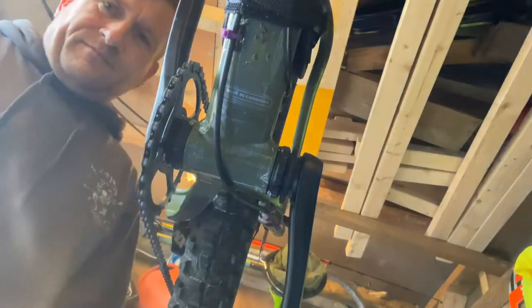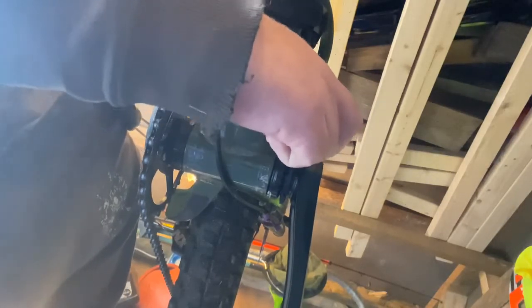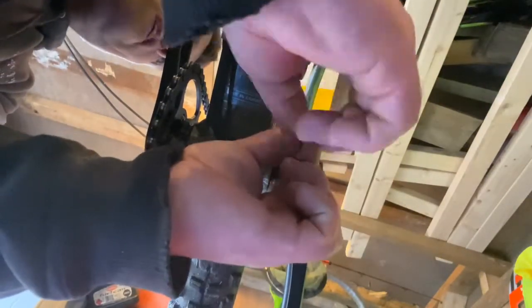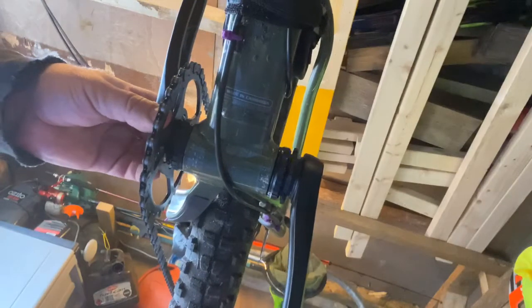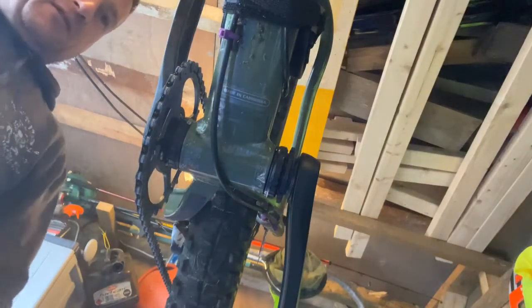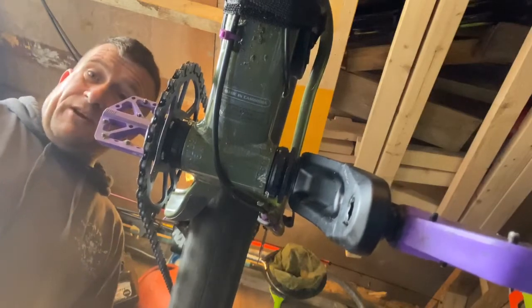Right, forgot to say - bit of an idiot. Wind that bit on and then pinch it up with a 2mm allen key, so that way you get no play in the crank set or in the bearings. Whilst you're trying to do it blind is not exactly easy - there we go, got it. Pinch that up. There we go, no play - otherwise you get the crank floating about everywhere and that's not really good. It'll put premature wear on the bearings and the crank set. There we go, it is all set, all done, all ready for a ride out tomorrow, maybe - hopefully the weather's nice.